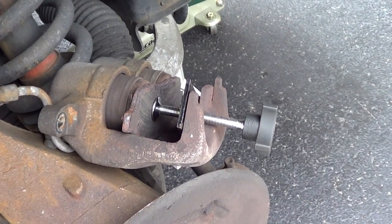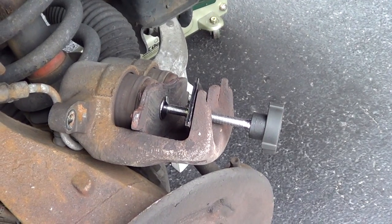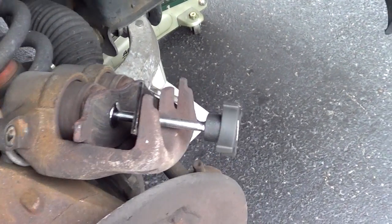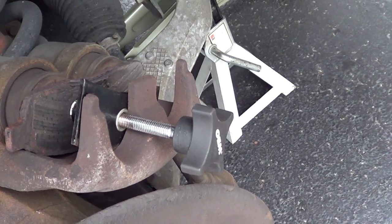This is a caliper compression tool. I'm using one of the brake pads to give me some more leverage, but just work it in slowly. If you have a single caliper piston it's easier, but you've got to go back and forth when you have two. Again, just try not to pinch that rubber, so you don't break it — because if you do that you've got to rebuild the caliper.